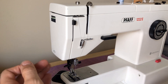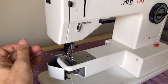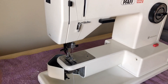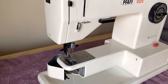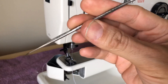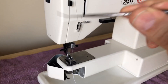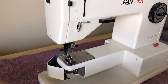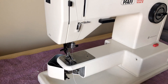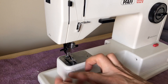I'm going to hold the thread and get my bobbin thread pulled up. Here's my little pick tool — I don't even know what it is, but I used it. I kept using smaller and smaller tools and was finally able to get that big thread nest out. It just took patience, wiggling the handwheel, taking your time — you don't get in a hurry.